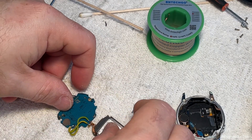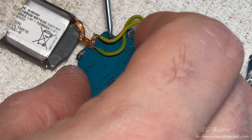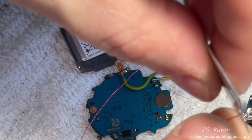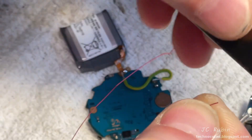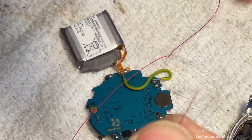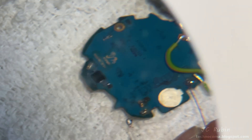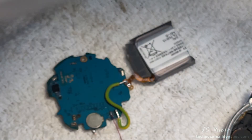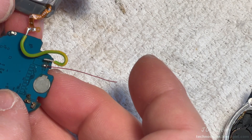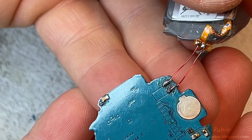Picked up some 30 AWG enameled copper cable. The current connection has been rigid but not delicate. I disconnect the battery and cable first to minimize any shorts risk. This wire is hair-thin and I have to scrape away the enamel from the first millimeter in all directions, rotating it as I scrape so all insulative material is gone. A thin layer of flux applied to both sides. I'm using two sets of magnification; these connections are four times the thickness of a human hair. I also applied some silver paint with a razor blade on corroded tracks. Here are the two wires now connected to the board and to the battery.